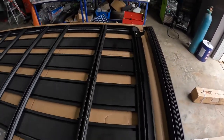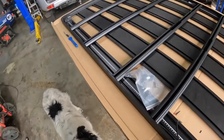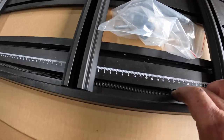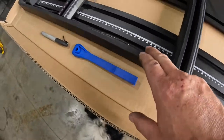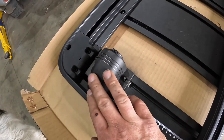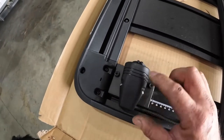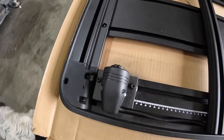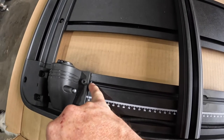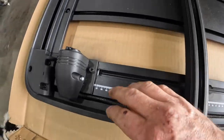We've done some modifications to this Rhino rack to make some stuff fit. The first one is running the wiring through the tubing all the way through here and all the way down. I've mounted an accessory socket at the rear for the lights and the bushwhacker warning. I've put a plate on that, mounted with tap threads into an alloy plate, and I've also cut this out with a die grinder so I can take the captive nuts through the slide and screw it in.